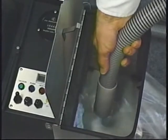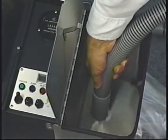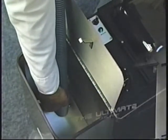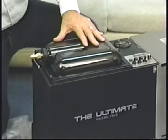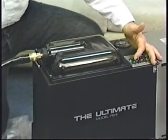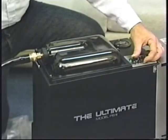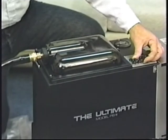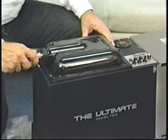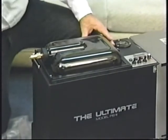To switch from dry cleaning to wet cleaning or vice versa, first suck the tank dry, then put the vacuum hose over the filter for 5 to 10 seconds. Insert the siphon plug and connect the pressure line. Then turn on the vacuum switch for approximately one minute. This procedure will suck all the solution out of the lines, heat exchanger, and pump. This also reduces the possibility of the machine freezing if you live in a cold climate.